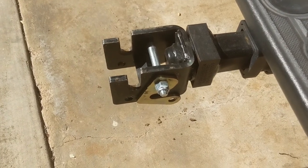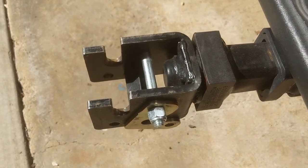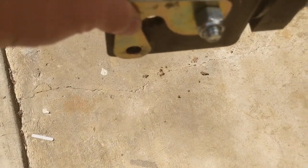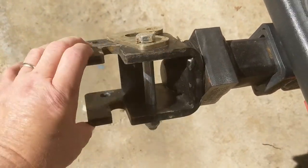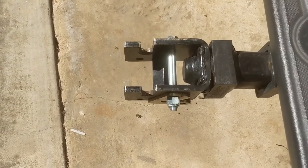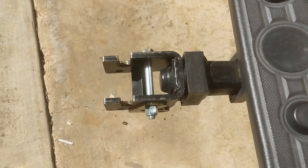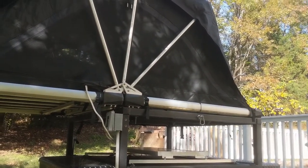This is how the trailer connects to my truck — it uses what's called a Lock and Roll hitch. The T-shaped part of the trailer tongue fits into this area, and little pieces fold up over top and are secured by a pin through the bottom. The trailer provides up-and-down and left-and-right motion, while the truck part of the hitch handles the roll. Theoretically the trailer could turn completely upside down and the hitch would still stay connected — we really don't want that to happen, but it's good to know.